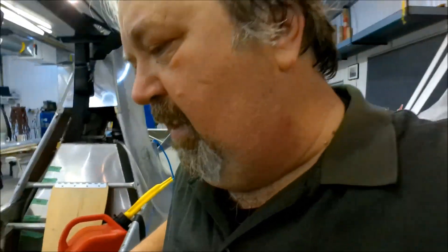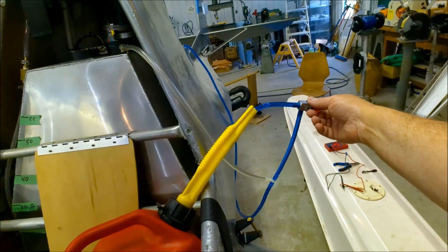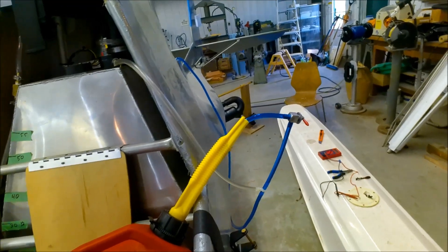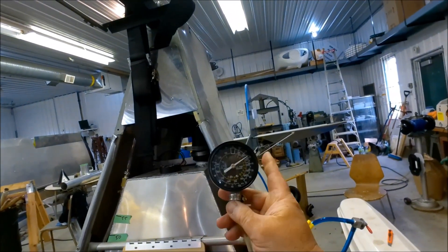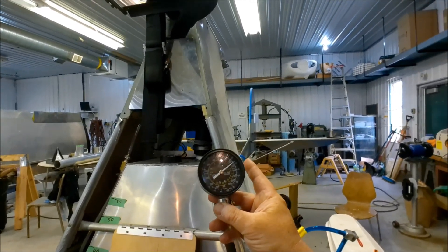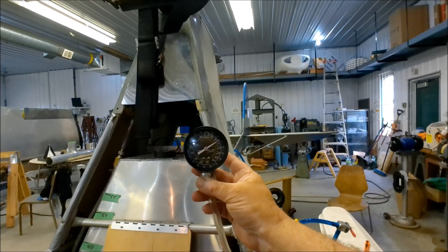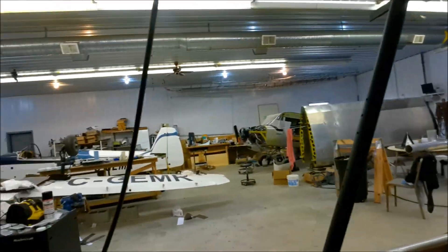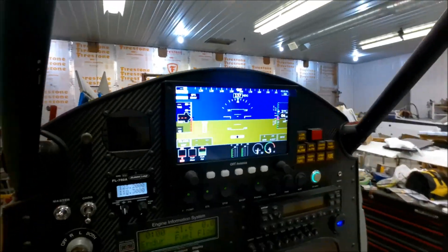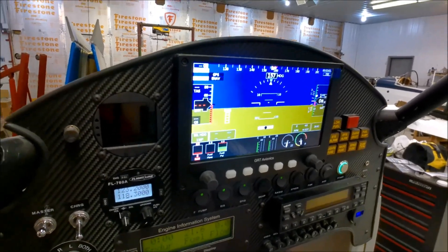Right now the fuel pump is running. Let me show you what I also had to do. Here's my fuel hose coming from the fuel pump. There's a valve I can open and close in order to drain it or release pressure. And then I cut this and put a T-tap into a fuel pressure gauge. Right now that fuel pressure gauge is showing me 4 PSI — just slightly under 4 PSI, but that's where it's at. This is a brand new gauge, by the way — I just purchased it today. Now let's take a look at what my EFIS is showing me. 3.9 to 4, which does match what I got on the manual gauge.